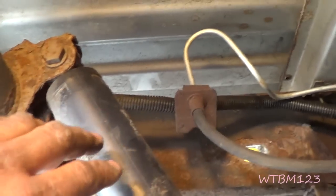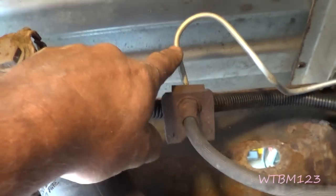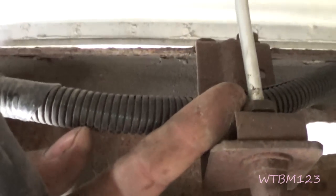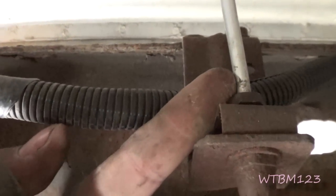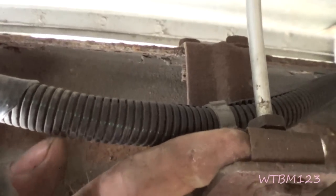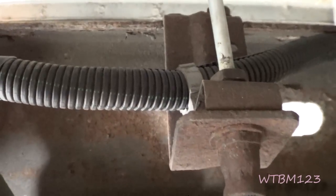From looking at the rear of the truck from the driver's side, this is where that brake line comes to. I just put that on the other day because I didn't have nickel copper brake line. You want to get that line nut loose first - spray it or use penetrating oil if it's been on there a while and you're trying to save the line. This clip here has a hollow spot where it's folded over. Once you get the line loose, you can take a screwdriver and push that clip right off, and there'll be the top of the rubber brake line.